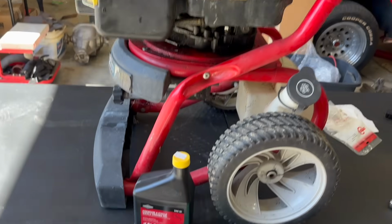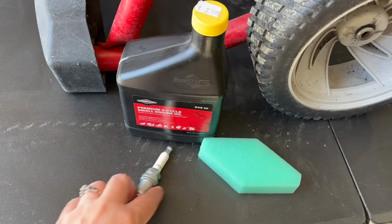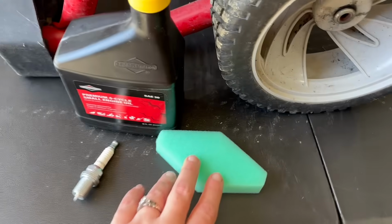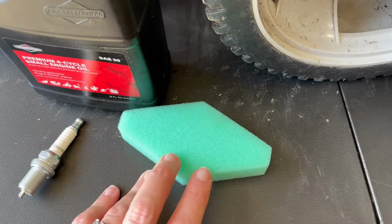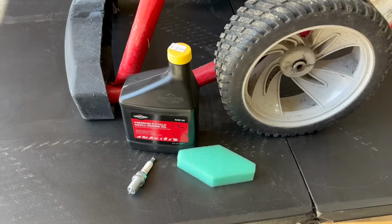Now he does want us to go ahead and service it. So just like the other overhead valve Briggs engine, it takes the RC12YC. The air filter is a 797301 and the same Briggs oil. I will leave them linked in the description box below.